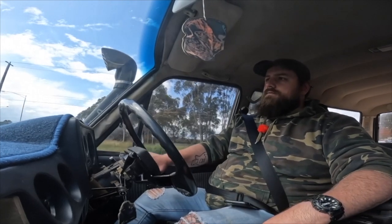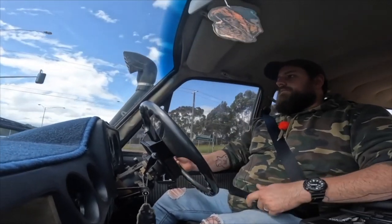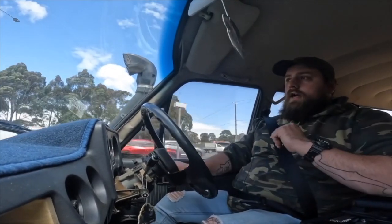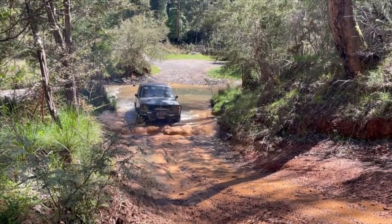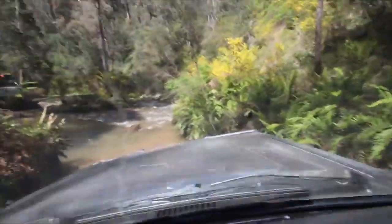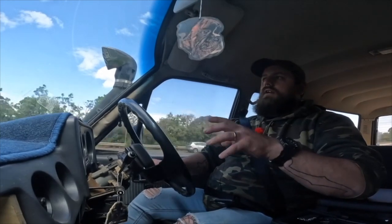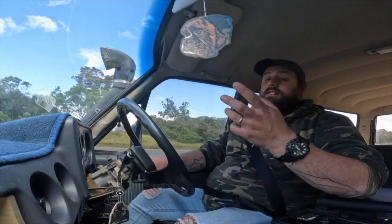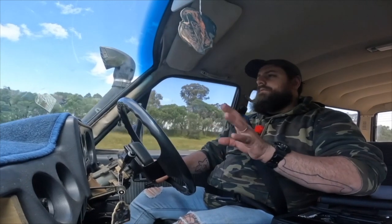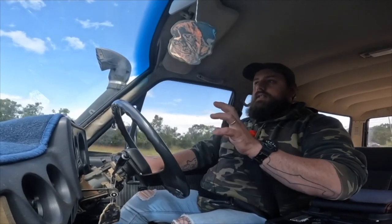In the 12 months of having it, I've not been blown away with it. The reason is probably more my fault and the fact that this car had a lot of mechanical problems when I did the conversion. I got the car running fine in the end, but it unearthed a lot of problems. I think I had a manifold leak for a long time — that was a big problem. Then I had a timing issue, and what was happening was the computer inside the Holley Sniper was trying to over-correct for bad timing, causing revving fluctuations, stalling, and flat spots in the acceleration.